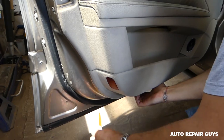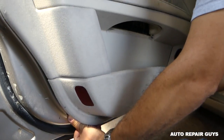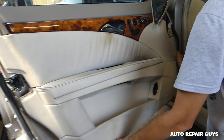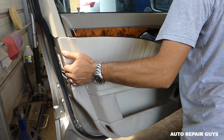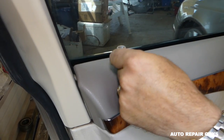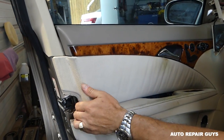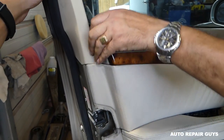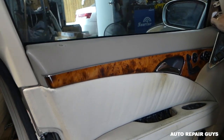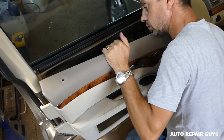With the pry tool, there are a few clips. A good tip: before you start, you should probably buy some replacement clips because they often go bad and sometimes they'll break. Pop them like that, then lift up. You'll need to unscrew this one counterclockwise. Sometimes it'll be stuck really good — that's because it goes into a seal. You can see the panel came out.